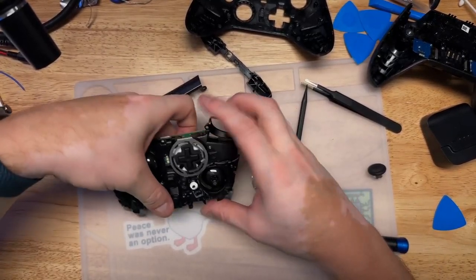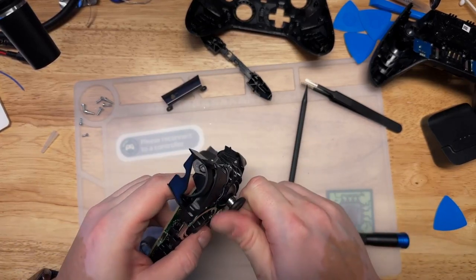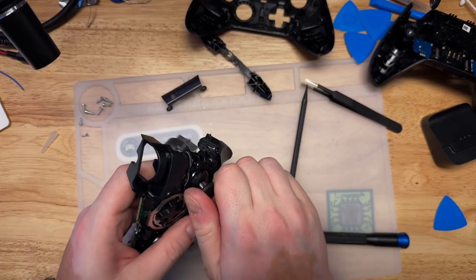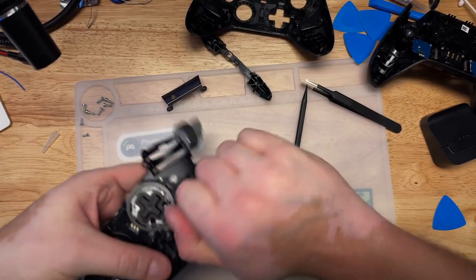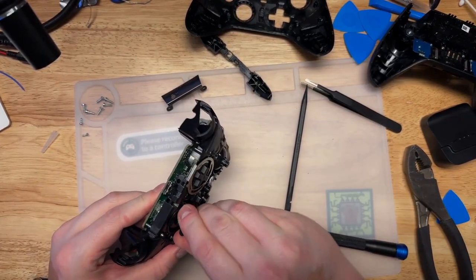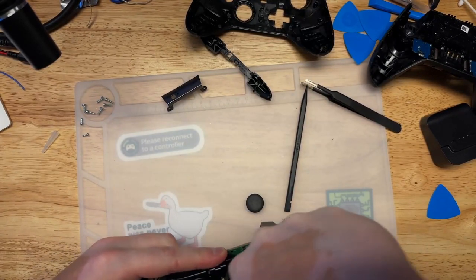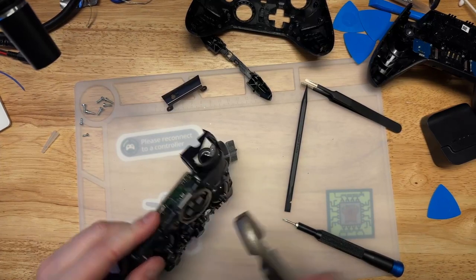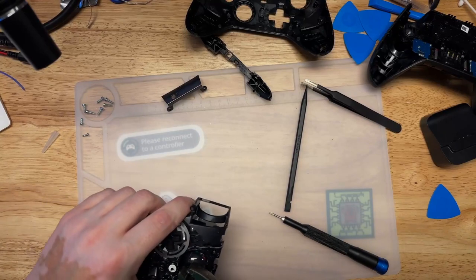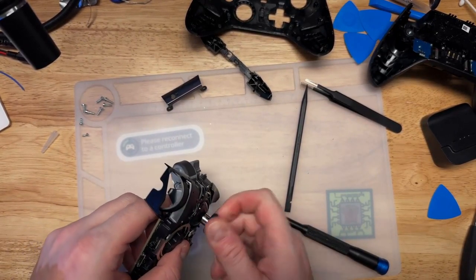The official instructions say to remove the thumbsticks. And they say to do that by using the cap as a screwdriver. But they also say it might require a little bit of force. So based on taking the front panel off, I expect that to be an understatement. The iFixit suggestion is to get it started with pliers as gently as possible to try and avoid scratching it. I think I agree with that assessment because this is not moving at all with the recommended method. Again, I don't think they intended anyone to work on this.